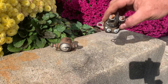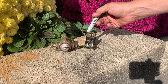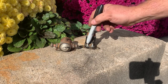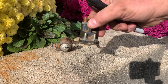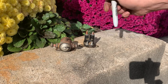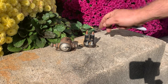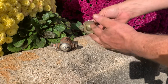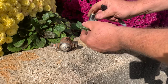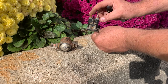This is a four-post solenoid. As you notice, there's four posts — battery in, battery out. Now the way a four-post works, these two on the bottom: it doesn't matter which one is ground and it doesn't matter which one is positive, but what's important on a four-post is that the frame is not the ground. When you connect this to whatever, this solenoid still needs to get an external ground.